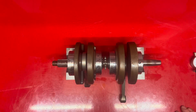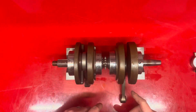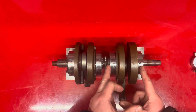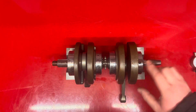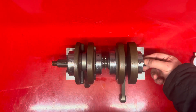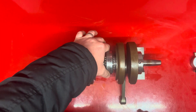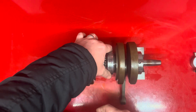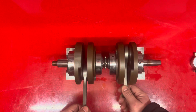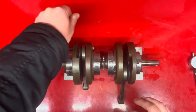So I'll give a quick run through what I check on the crank. If you've never worked on one of these cranks before, it's an idea to get two elastic bands — maybe that length, from the edge of here to the edge of here, quite thick. Put it over the whole assembly onto here, twist it, then bring it back and put it over here. Because the outer race can slide back and forward, so it could slide far enough that your needle rollers could drop out. So I would definitely do that first, and you want to do that on both sides, because all four of these are the same style of bearing.